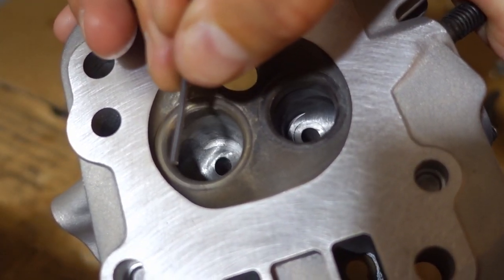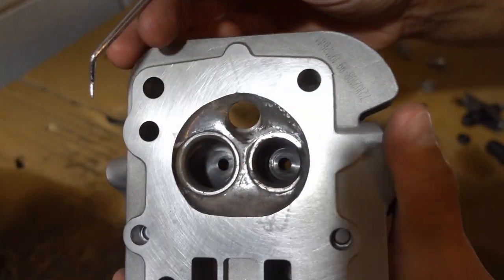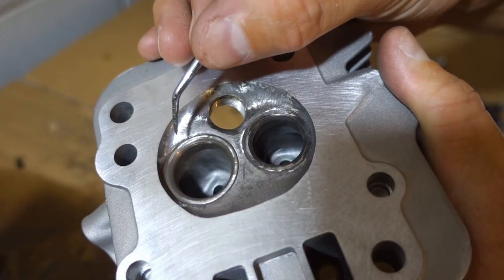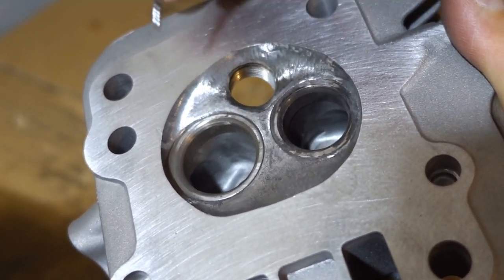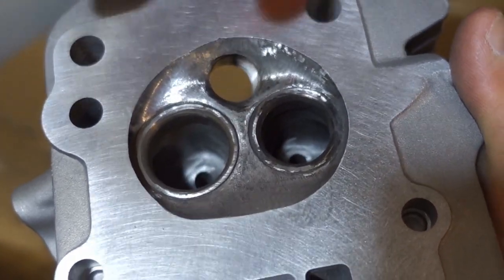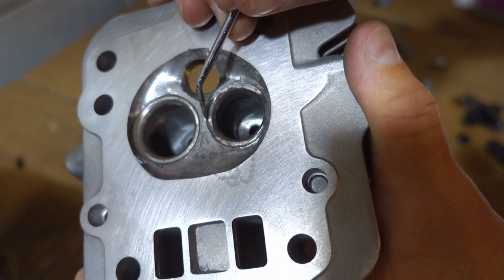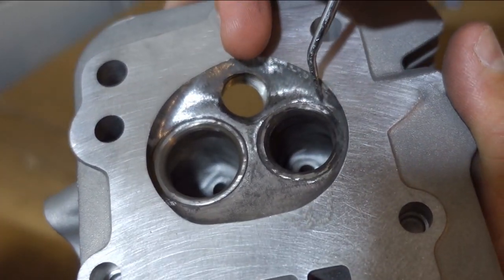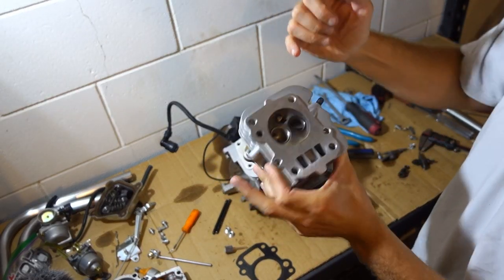This is the one you really have to exercise caution with because it's very easy to damage your valve seats. All I've done is take my sanding bit and knock down the edge, because when those intake and exhaust gases come in we don't want them getting hung up on this lip — so this is now smooth. There used to be a very sharp transition between these two. On the exhaust side I couldn't quite knock it down as far as I wanted without damaging it, so I just ever so slightly knocked down and polished the corners of those valves.